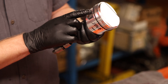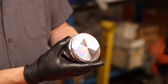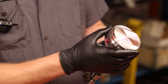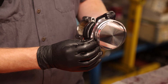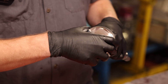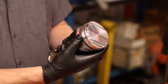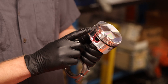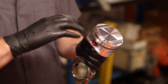Make sure the break inside the oil control ring does not overlap as you install it. Once you have the first one on, it'll stay in position. Then do the second one the same way — set it inside the groove and roll it around. These ones are pretty nimble; you're not going to break them unless you're really aggressive. Now that you have your oil control rings installed, we're going to move to the second compression ring. One thing to mention: for the oil control rings, there's no real orientation — no top, no bottom, you can put them on either way.